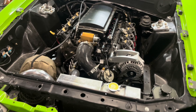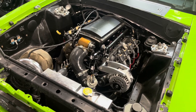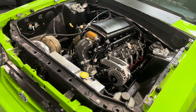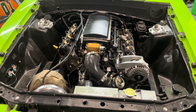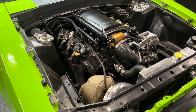These two 210s hopefully will get me where I need to be injector-wise. I actually have a second fuel pump on the way — I went with an AEM 400 liter per hour. I'll be adding that with the Dominator on basically a boost reference, and then the MagnaFuel will go on when it sees boost. We'll make another video on that, but today we're going to focus on the injectors.